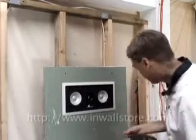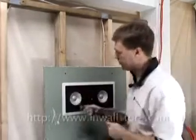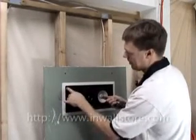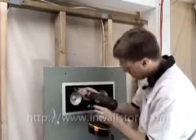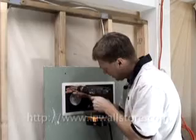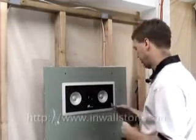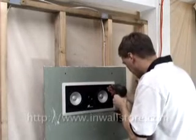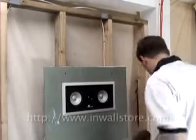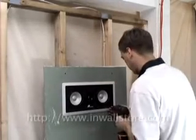So now we just take these sides, and you're going to go in at an angle a little bit because you're not exactly over the top of these holes. If you're a perfectionist, you might take it right to the corner, drill yourself another hole right there. It's going to go straight in the side. But we're fine here. Just going straight in. That's going to attach there. I'm using about a 3/4 inch drywall screw here. And just go in there, suck it up, and do it all four corners.